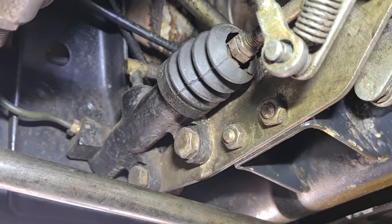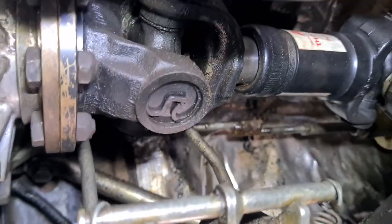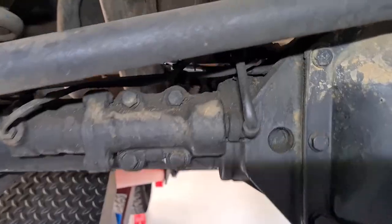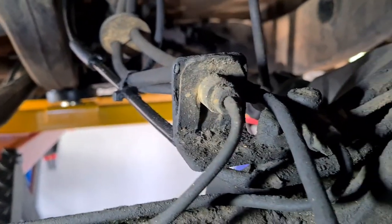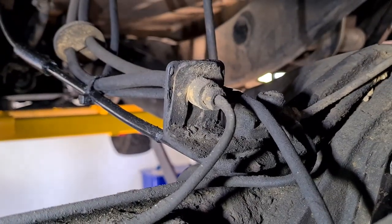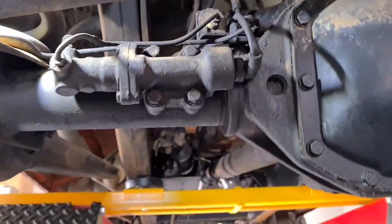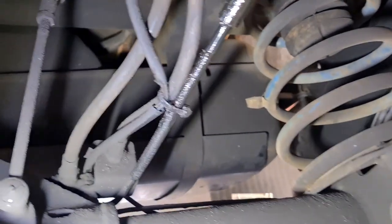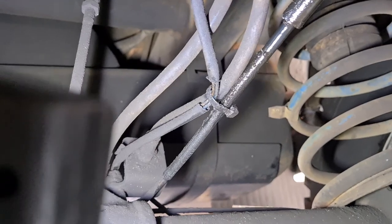You can see what are the front and rear master cylinders — this is the rear master cylinder towards the back of the car. These go up to the levers in the engine bay, so pulling them activates the springs, pushes the master cylinder, and then through rigid brake lines it runs to the rear of the car to the slave cylinder. There's a flexible brake line at the rear and a bleeder valve on the rear slave cylinder, plus the electronic switch with the boot over it that tells you on the console that the lock is activated.